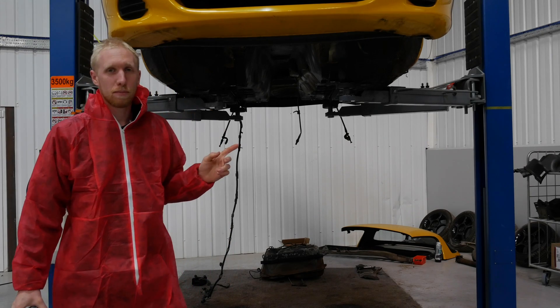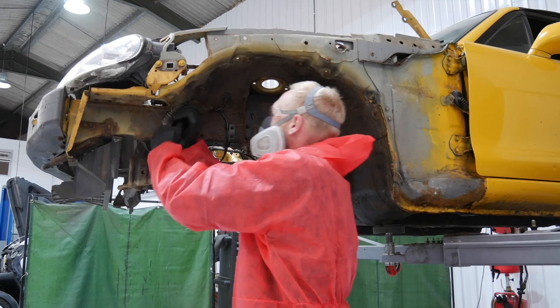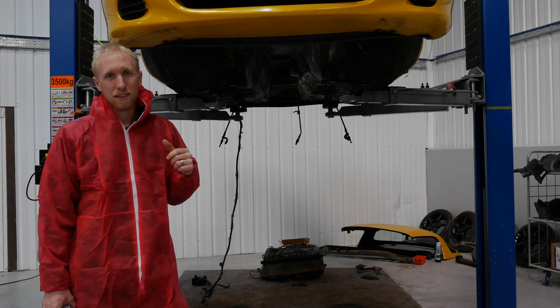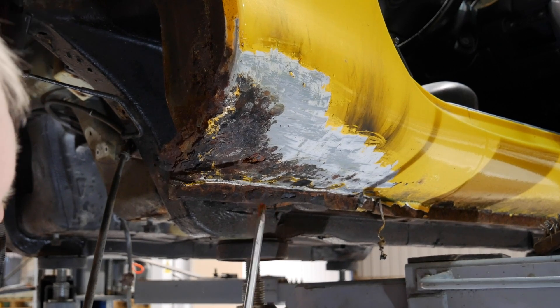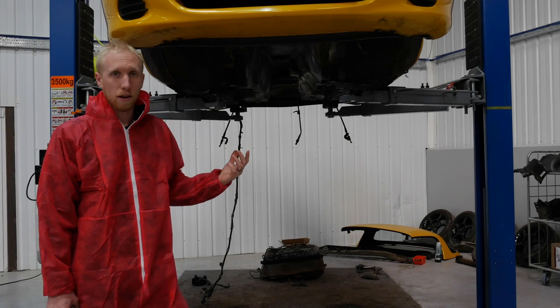Welcome back to episode 3 of the Electric MX-5. I'm going to be looking at the underside of the car, cleaning it all down, and finding all the hidden bits of rust - quite a few of you guys have pointed out locations to check. I've had a look at the driver's side sill, which is definitely going to need some repair work - I'll need to cut that back and look at welding a plate in. I'll get that finished on episode 4 as there's quite a bit of work to do.